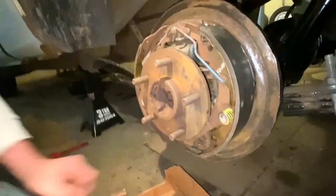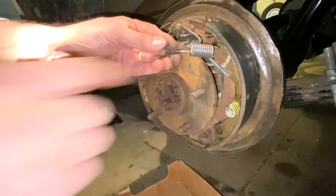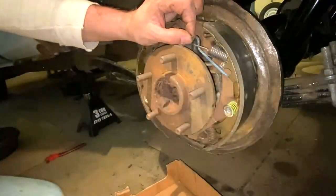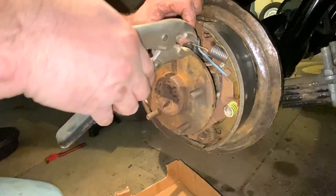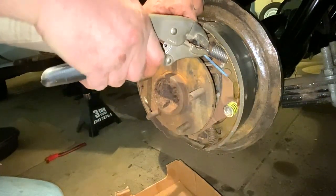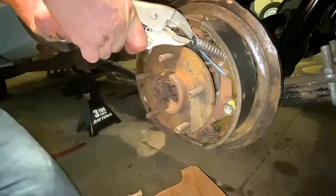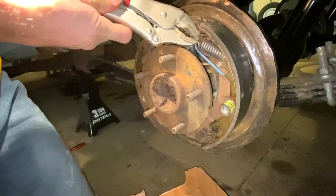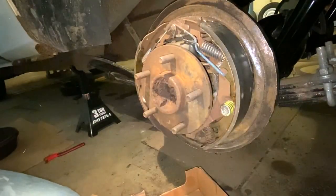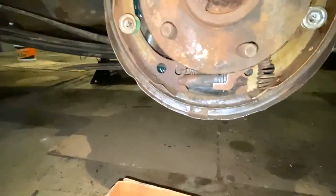So we got one spring left, and that's this one here. And that goes in through a hole in here like this, comes up like that, and then it's just gonna hook on there. So again, I just grab my channel lock. I try to grab it down as far as I can, make it easier, and just pull it, and up and around. Bada bing, bada boom. There we go. It's all there. It's adjusted down to where we need it. You can see how it's all in place. The springs are all in place.